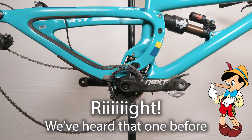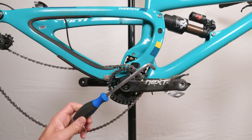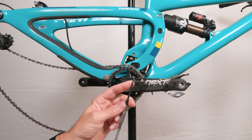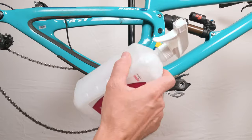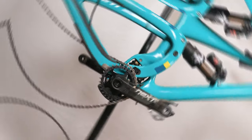I'll try and keep this video short. The tools we're going to need right off the bat are an 8mm Allen key, or any kind of pedal wrench, or any kind of 8mm wrench with an Allen head in order to take off the spindle. A 2mm Allen key in order to loosen the pinch bolt, the preloading bolt in the back. We're going to need some grease, alcohol, and some paper towel. With all that being said, let's go straight into the job.